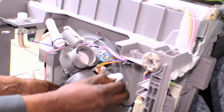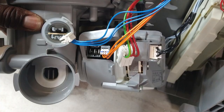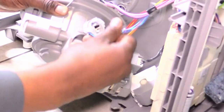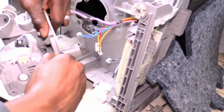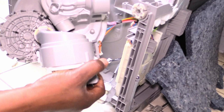Now gently remove the sump or just let it pop out. Here's a tip: take a couple of pictures so you know where each of the wires go when it's time to replace the circulation pump. Remove each of the wires by gently pulling them from the sump — the goal is to keep them intact. Now pull the rubber brace off of the sump. On the other side of the sump, I twisted the circulation pump left to right until it came off, just like a vacuum hose.